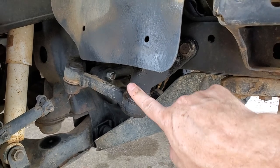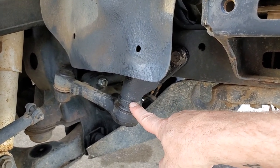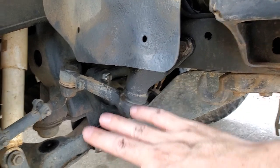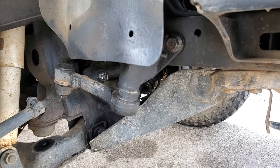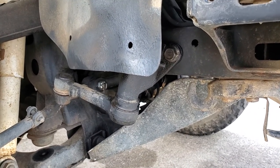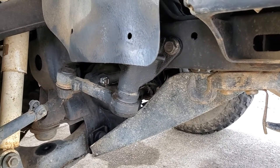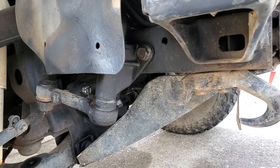That's the upgrade I went with — brass bushings that should last the lifetime of the car. That was just Toyota having a bad day deciding to go with plastic. You can upgrade the one you have, have the guy do it for you, or there are people that make full custom idler arms — the high dollar option linked on my website — which is the way to go if you're doing lifts, big tires, or rock crawling. Number two is the clutch pedal bracket.